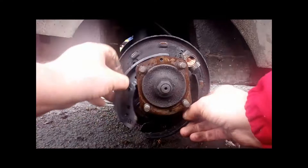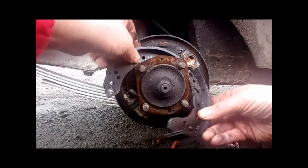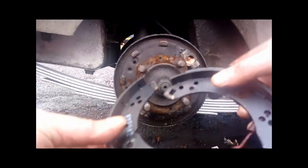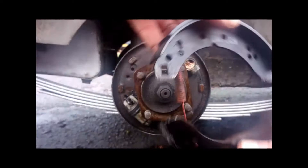When getting the shoes out of the location, you have got the spring to fight against — just watch your fingers so they do not bite you. Then just wriggle the shoes off the drum. If you can get these springs undone that is the easy way. These are actually scrap even though there is plenty of meat on them, purely because of the contaminant.